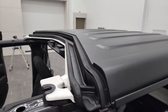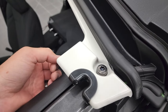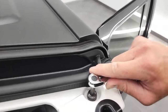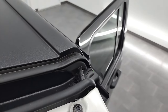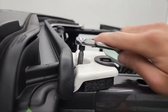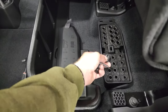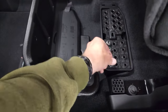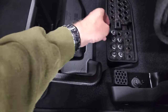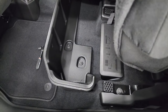You're going to have two more bolts to undo on the top — the first one is right here and then there's one on the other side. Those are also Torx 50. Grab your ratchet and take them out. I suggest getting a ladder for this so you don't fall. The cool part about Wranglers and Gladiators is that they give you a spot to put all your hard top bolts right there — the ones on the other side are for your doors. Put the bolts in there and put the cover on so you don't lose your pieces. Now we're ready to take the hard top off.